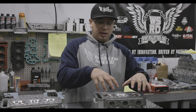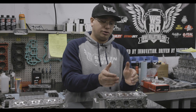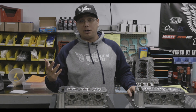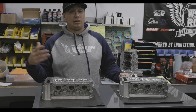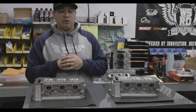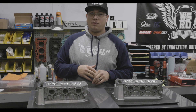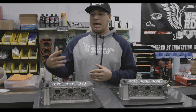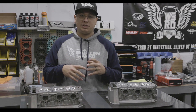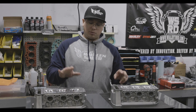When we do the actual porting, we want these combustion chambers centered in the cylinder — no weird overhang or anything like that. So these are safe to use on higher bores. Not saying you can't put it on a 74, 75, or even larger — we just tried to maintain not having any weird overlap with smaller bores. Our program is built around the 20-over piston, so 74 and a half bore. It allows the engine to be serviced again if you want to go to a 75 bore, and it assists in using a head gasket that has more potential for sealing. There are a lot of advantages to why we tend to run a smaller bore overall, and these heads were designed for it.